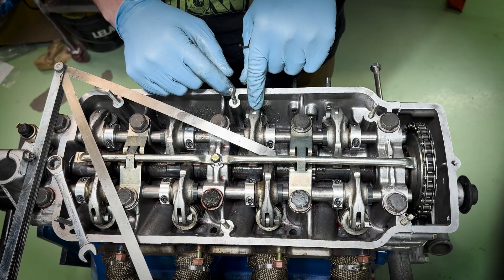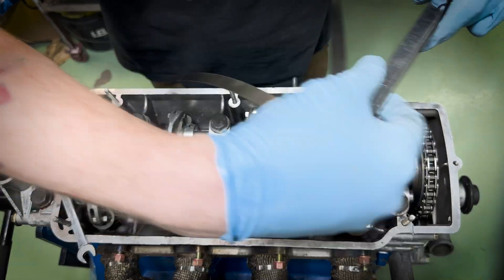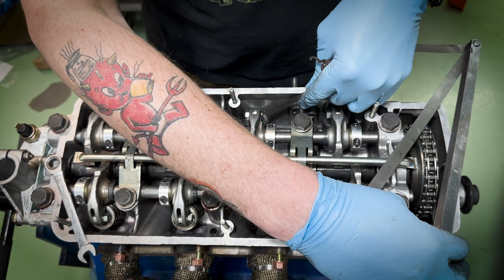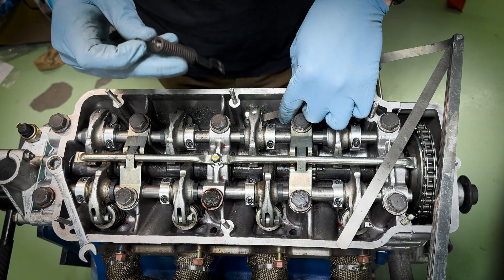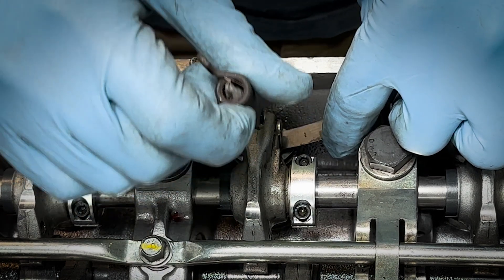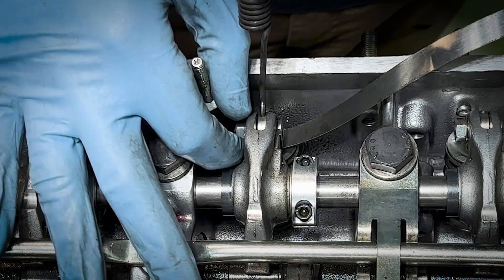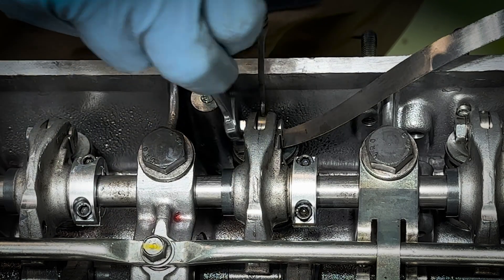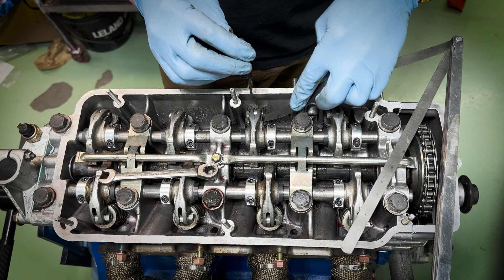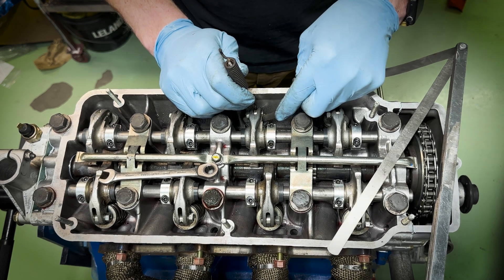So I pulled these two out. You're doing it on the valve, not on the cam - you're not measuring the distance between there, we're doing it on the valve itself. I'll take my feeler gauge and set it up to hold itself, and then I can slide the .008 in there. Grab my little tool - you could use an Allen wrench, there's lots of different ways people have done it. I like to tighten it down to where I can't pull the gauge out, get a little more tension on my locking nut so it doesn't move so easily. We're going to start with it nice and tight and then push it forward until I can just move the 8.